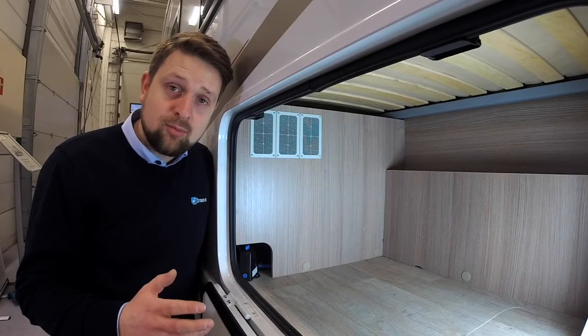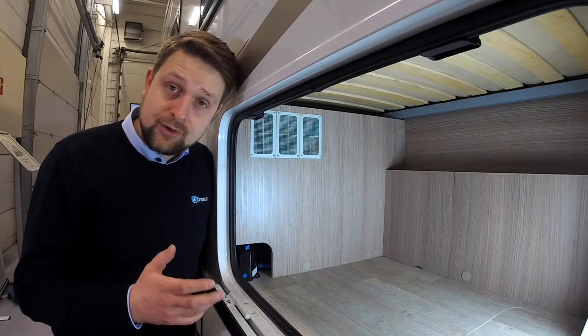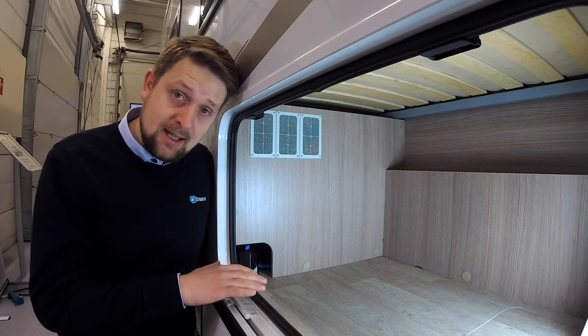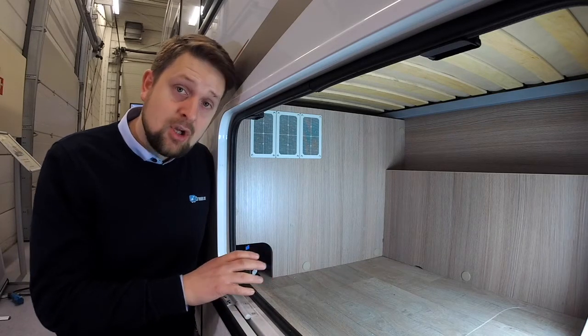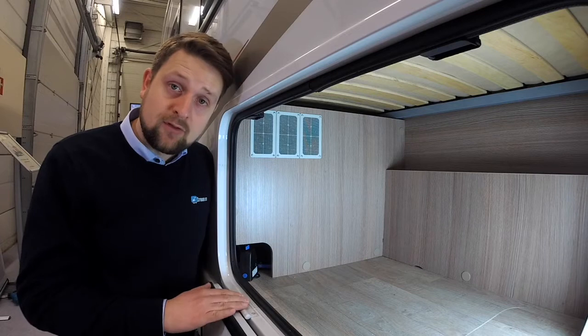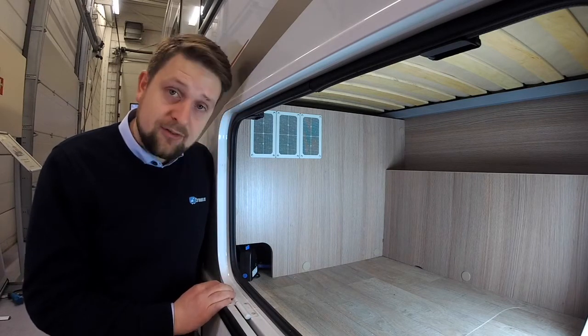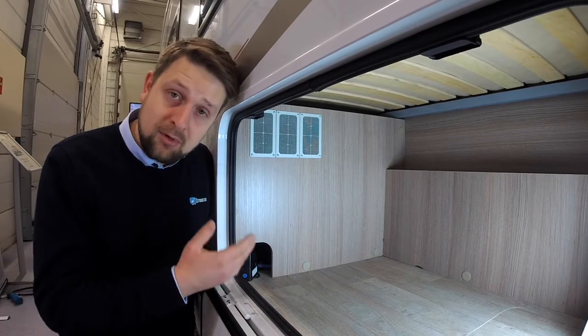And so if you want to fill the water tank, you must replace the yellow stopper so that the water doesn't drain out. The hot water tank on rental vehicles has a frost control, so if it falls below 5 degrees inside the rental, by the water tank, it will drain the hot water automatically. So it is important to ensure that the frost control is shut before filling hot water into the tank.